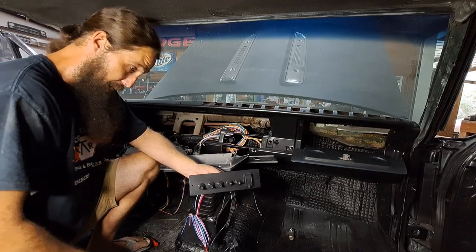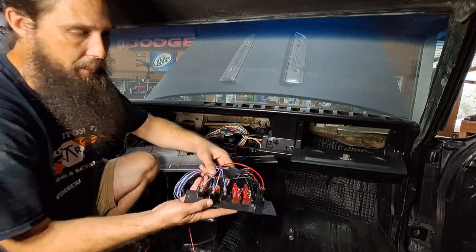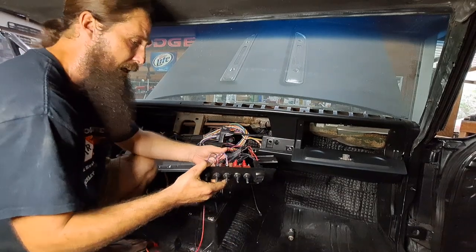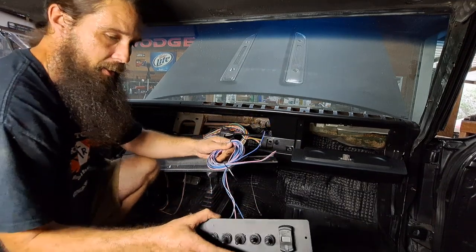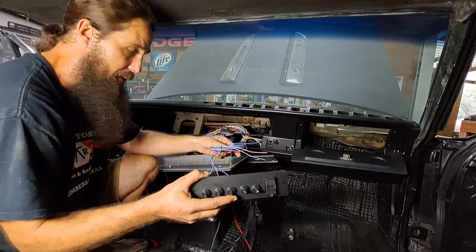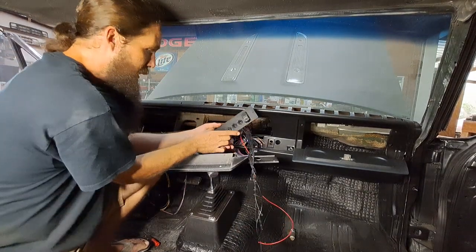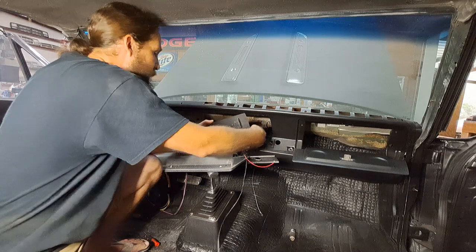The quality of the wiring that came with that kit is a little iffy, but it's wired up good. And as you can see, we've got quite the jumble of wires here. So let's start. We've got these guys right here — those are our three main switches. And they are going to be passing through a grommet in the firewall to trigger our relays that are set outside. We'll take a look at all that good stuff in just a few minutes.